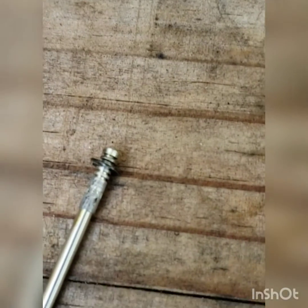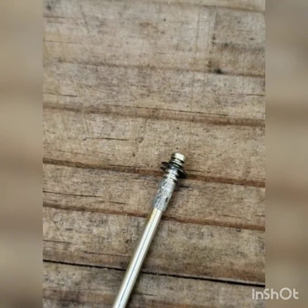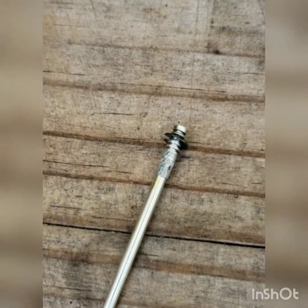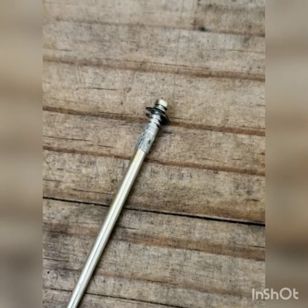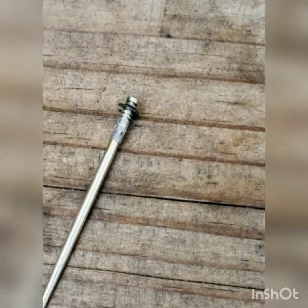If you want to make it richer — but if your bike is starting to bog, it's more than likely because it's too rich and the spark plugs aren't able to burn the fuel you're giving it. That also goes hand-in-hand with the jetting. The main jet could be too big and you might need to downsize a couple of sizes smaller.